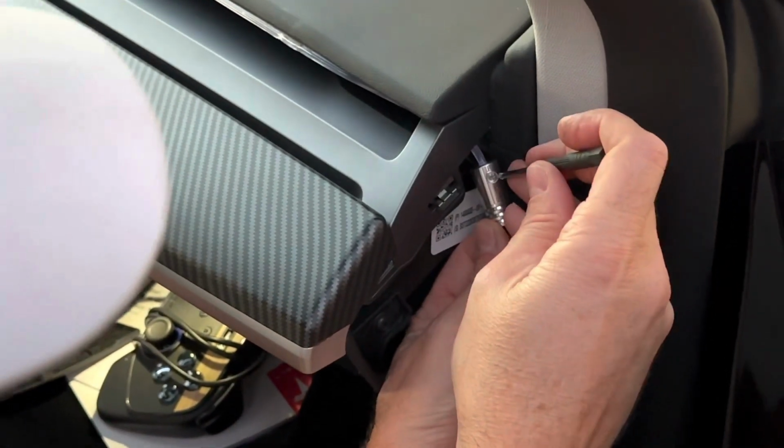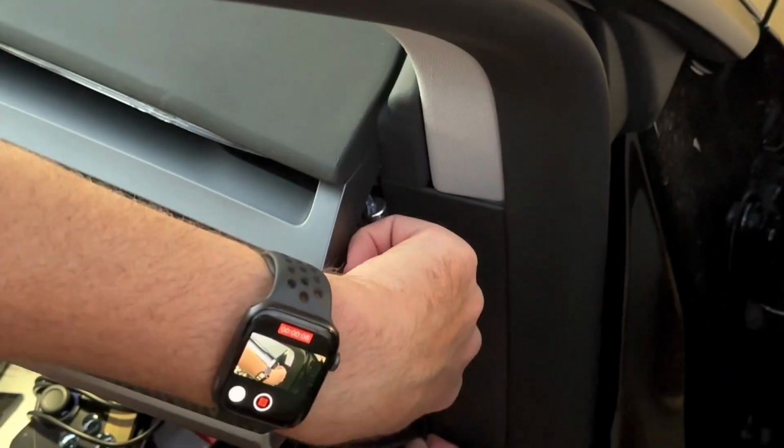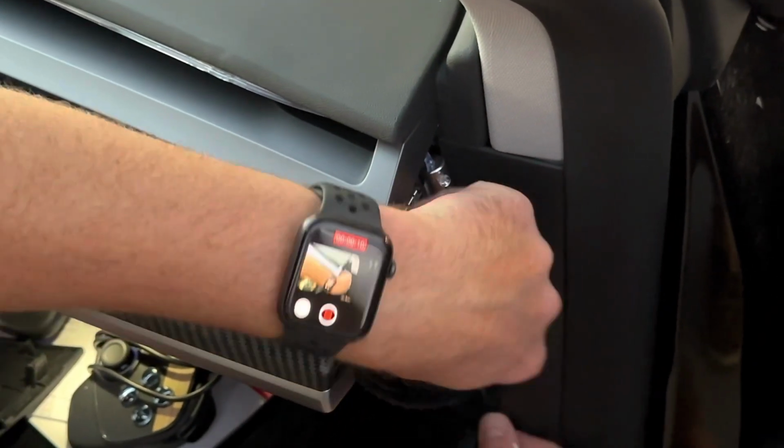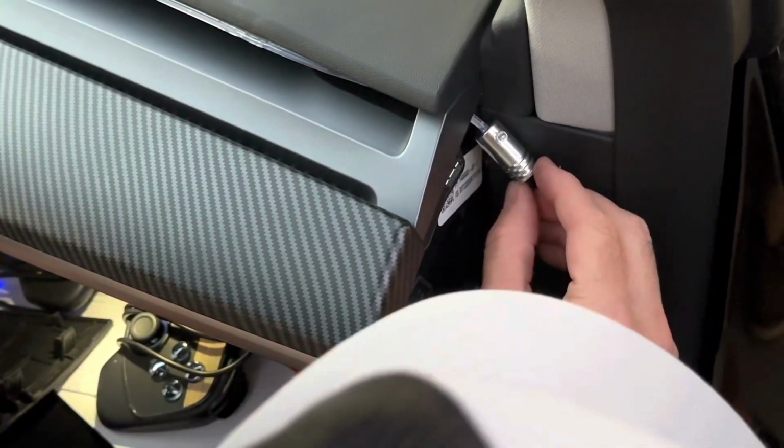Now to install the LED light on the end of the light strip, you just have to cut back the end of the light strip about a couple inches so we can install that on there. And then make sure you leave about 4 inches right here so that this can install down far enough where it's not going to impede the cover to be put back on.